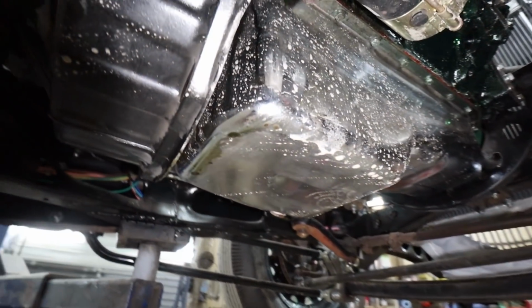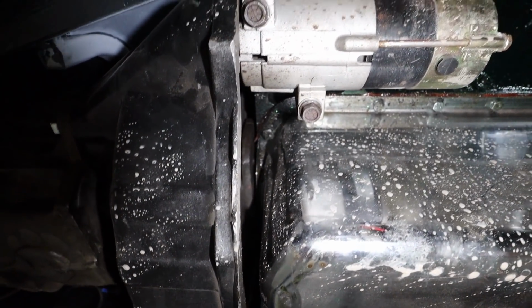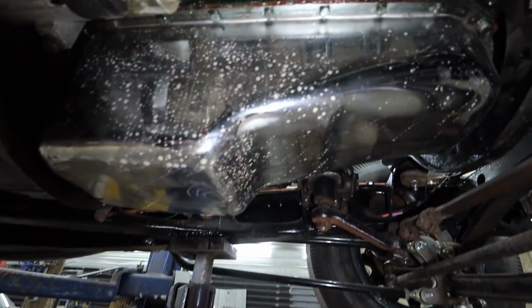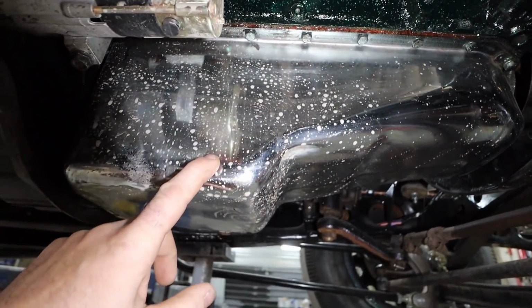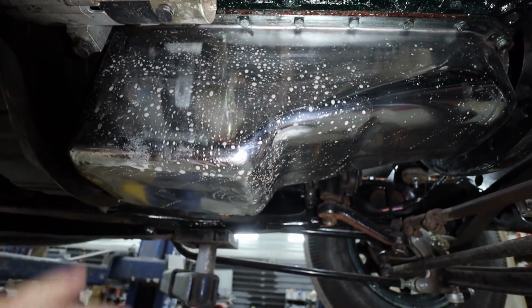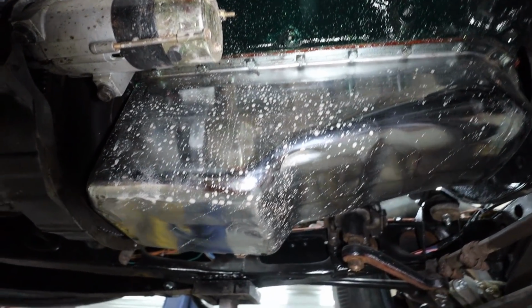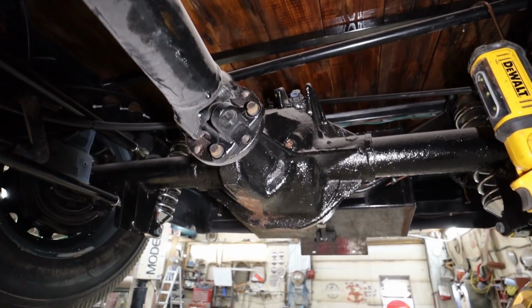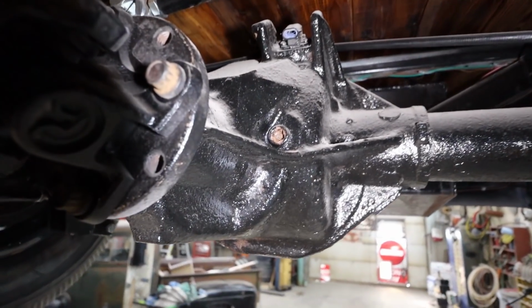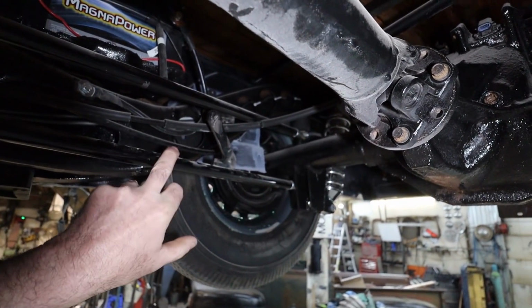I know I'm going to have to address this oil pan. Whatever. I guess that gasket was no dang good. So you can see it leaks a little bit back here. Kind of marks its territory everywhere it goes. So I might see if I can find one of those Felpro one-piece gaskets. Although this oil pan being those crappy chrome ones is probably my problem, but it's on the truck, so we'll just use it. Anywho, first things first, we will deal with this plug, to which I'm just gonna weld something to it because I think I have more plugs, so I can just put a new plug in there. And then we'll weld up these bars.